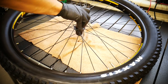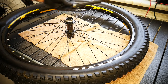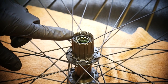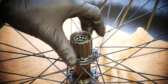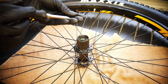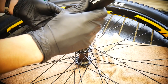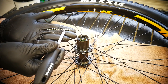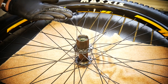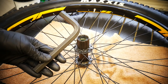Now it's time to remove the axle and then we will have access to our freehub body. Have some nice tea because it will take about 45 minutes. You can remove the balls — especially if you're going to service the hubs, it's also a good idea to remove the seals. The seal on the freehub body side you're going to need to remove anyway. Count all the balls because it's not always the same number on both sides, and there will also be lots of balls inside the freehub body, so counting those is a good idea.